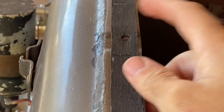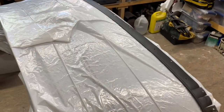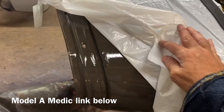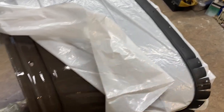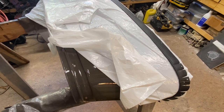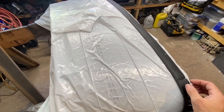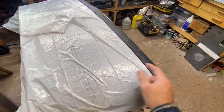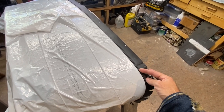I went back on the friction tape and just punched it with a set of regular hole punches to make it all nice and neat. Mark Moran and Eric Winninger brought something to my attention — the welting needs to be painted the actual body color of the tank. Originally it would have been painted in the car all at one time, but I don't have that benefit. So I'm going to mask the whole tank, lay the welting in place, pin it with clothespins, then paint the welting. Then we'll one by one pull the clothespins out and pull the bag out from under it so we don't distort this and crackle that paint.